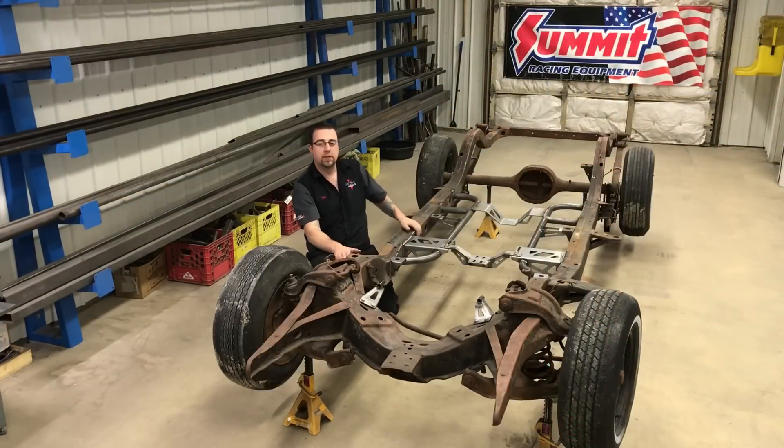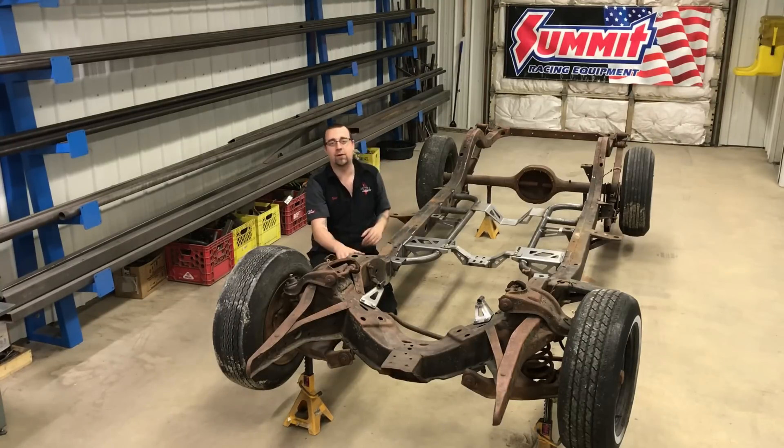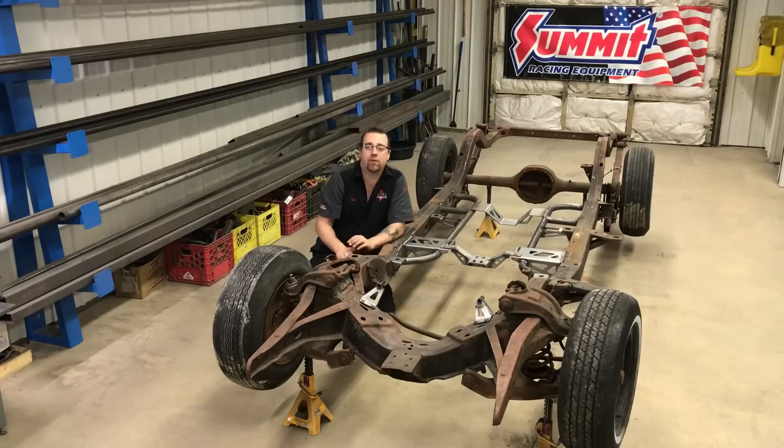We're done with welding now, and that about wraps up the install of the Summit Racing Tri-5 Frame Reinforcement Kit. At this point you're ready for the body to go back on to receive your small block, big block, or LS motor of choice. In this particular setup we're doing a 5.3 LS with a 4L80 transmission, and with the positioning this offers, the oil pan clears the factory steering and that big 4L80 transmission fits under the floor without cutting the tunnel open. If you've already picked up your kit and you're ready to install, get to it. If you haven't, head on over to summitracing.com and order yours today. Thanks for watching.